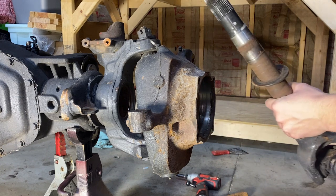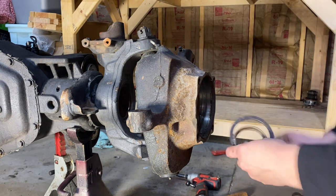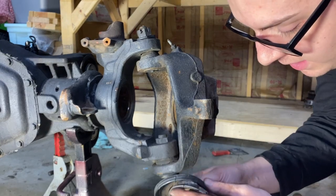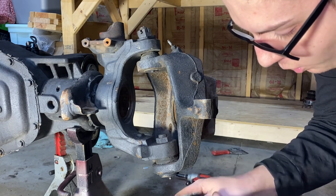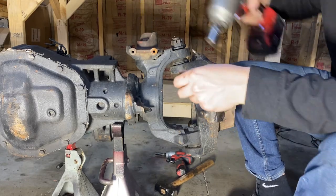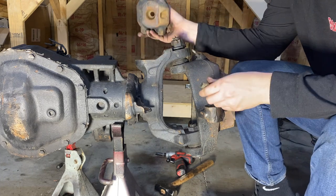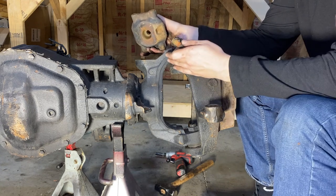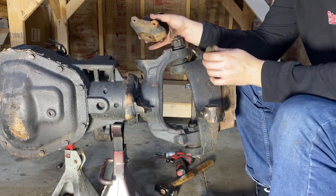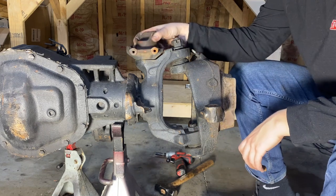I got that axle shaft completely out. I'm going to take these plastic and rubber pieces off — these are your old seals. There should also be one right here but it's completely gone and deteriorated. You do have inner seals that keep it from leaking oil. This coilover conversion bracket will be replaced with a bracket from PMF Suspension, a sponsor on the channel, so you can swap from coil springs to coilover conversion.